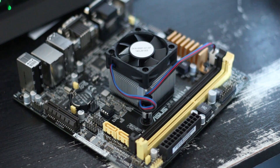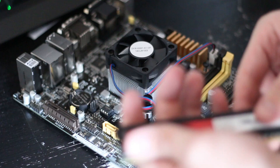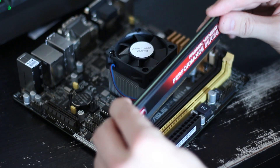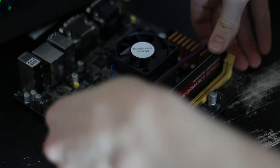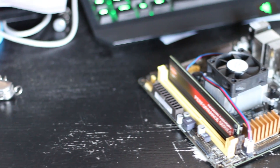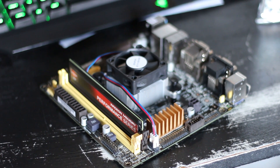We do have some RAM, and if you haven't ever installed RAM before, this is probably the best time to start, as DDR3 is very easy to install. All you have to do is push the little clip at the side, match the notch, and then literally just slide it in until the clip at the side clicks in. Make sure that it's nice and level. I recommend doing this before you plug in the PC, so you can test the components afterwards. Once that clip is in the right position, you're basically finished building the PC, minus a hard drive and a power supply, as you've already got graphics, processor, memory, motherboard and cooling all set up.